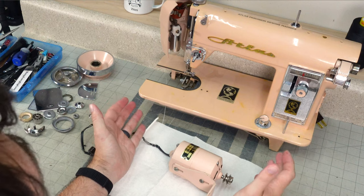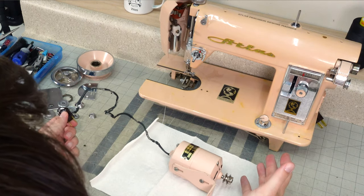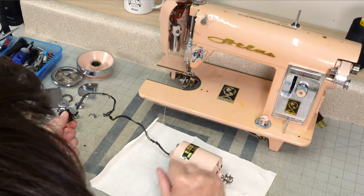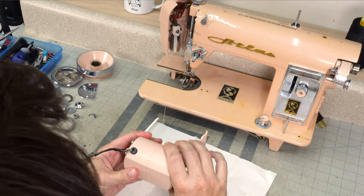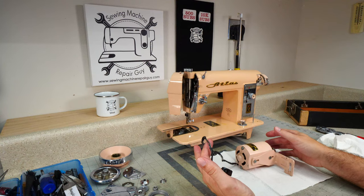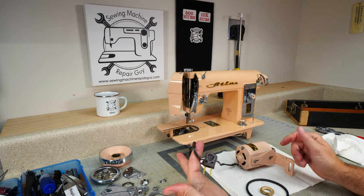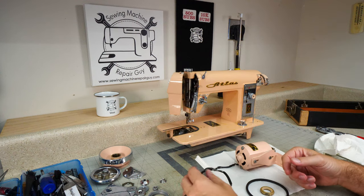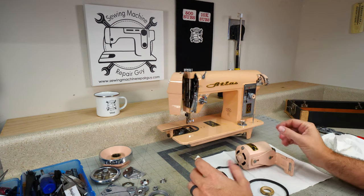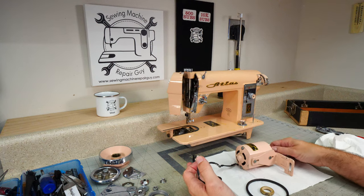So when you get to this point in a machine, I want to contact the person who owns the machine to see if they want me to do this, because for one thing, the motor may not survive me pulling it apart and attempting to reconnect wires to it. For another thing, this cable costs money, so I'm going to be replacing the belt, the tire, and the cable to the motor for this machine. And that's a minimum. That's not even addressing the potential problem with the pedal.